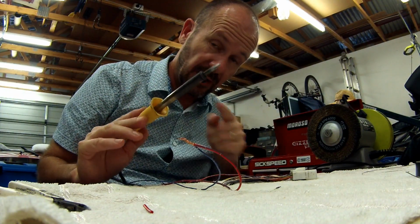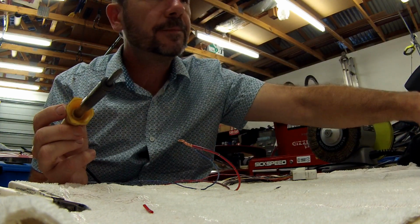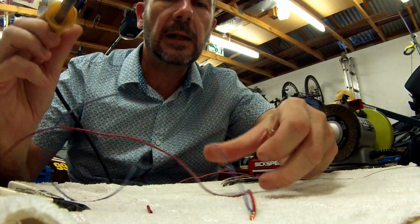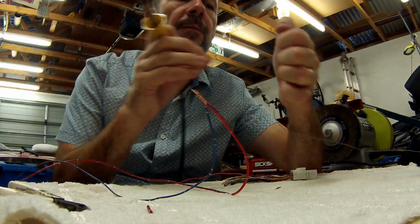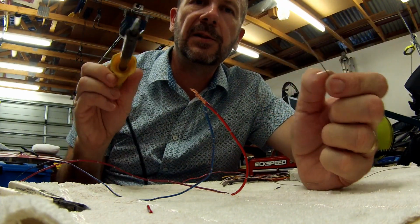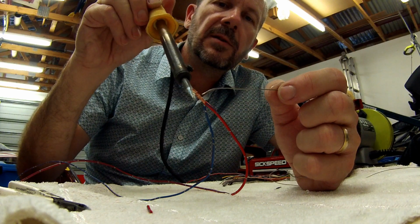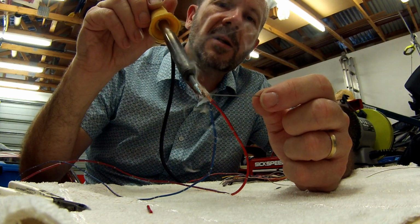And if you want to make it super, super strong, which is what you should be doing anyway, you get a soldering iron like this. Don't touch that bit, very hot. Get some solder. And I'll just put that somewhere where you guys can see it properly. That's the problem with wire, it moves around too much. Okay, that's good enough. You get the soldering iron and the solder, and this solder has got flux inside it, which helps the solder to flow. Basically, you put the solder onto the iron and the copper at the same time. You just feed it in.